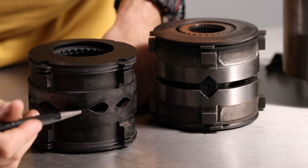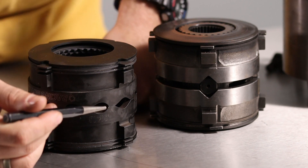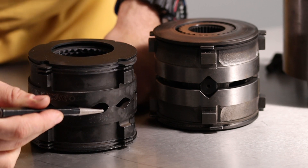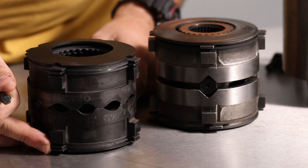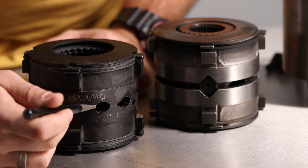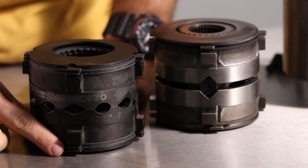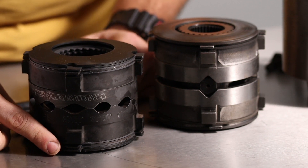The second option is one-point-five way: 30 degrees on throttle but 60 degrees on coast. This 1.5-way 30-60 setup feels more forgiving for drifting for less experienced drivers, and suits hill climb, asphalt rallying — a more forgiving option overall. The third option is also 1.5-way but with 50 degrees on throttle and 65 degrees on coast — the most forgiving, best solution for grip driving from beginner level at track days up to pro-level circuit driving, time attack, sprints, and so on.